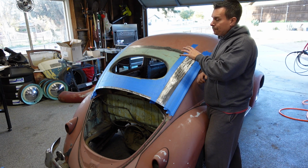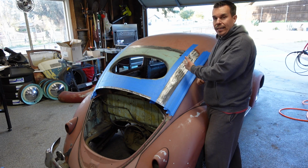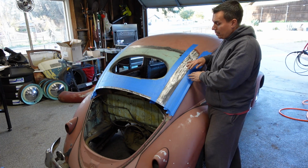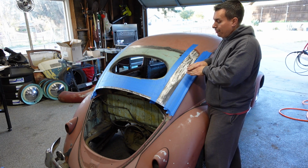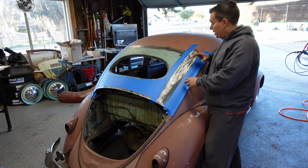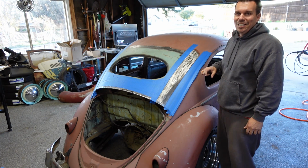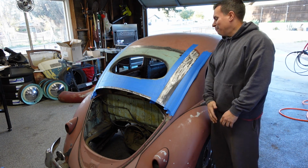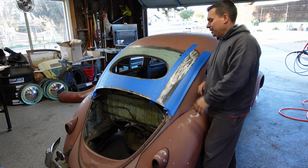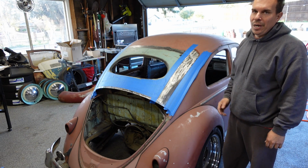as long as you mix it well, add the right amount of hardener, and we're not caking it on. You notice that when we fit this back section on, we fit it good, where we don't have crazy low spots with an inch or two of filler. We're going to have minimal filler on here. It's going to be prepped right, and it's basically going to stay on here for the lifetime of this vehicle. It's not going to crack.